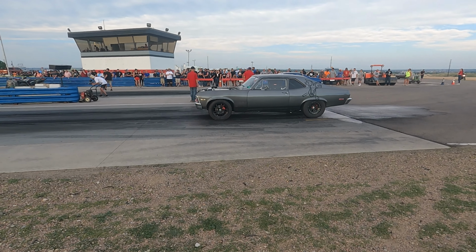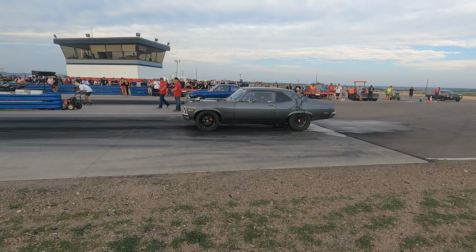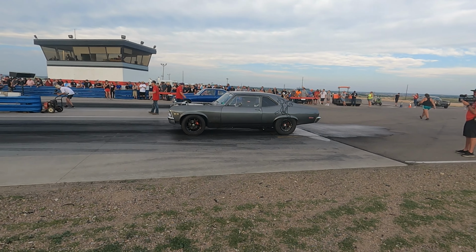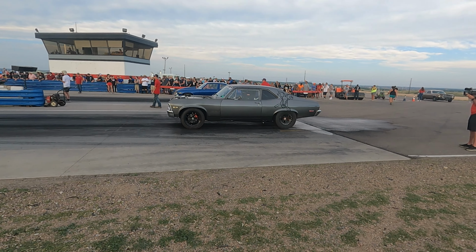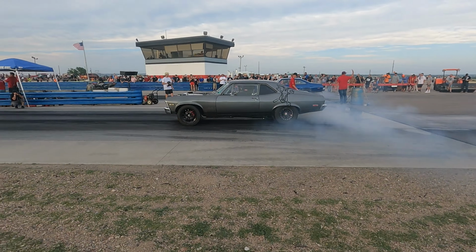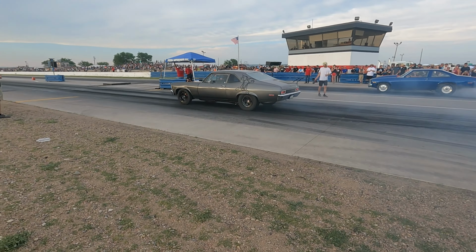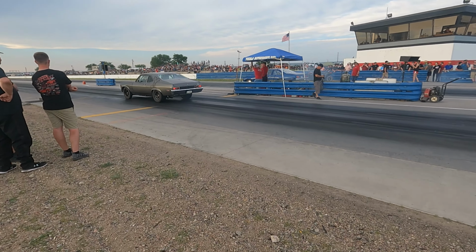And it's just exacerbated. We're running 3 fuel pumps, 2 electric fans, and an electric water pump. And those 6 items alone right there is going to be probably 60 amps high load at idle. And so we needed something that was putting out at least 100 amps at idle to support those, not to mention the electrical system on the car and then the EFI system.